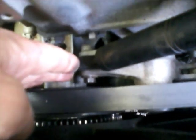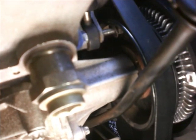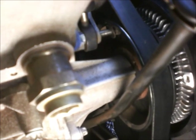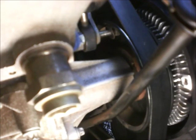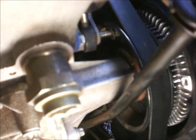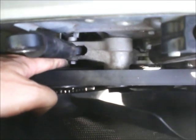Let's see how far it goes — if I can lift the shock. Of course, as usual, something is in the way. The bolt itself will come out, however its washer is hitting the pulley — the belt pulley from the water pump. There is space for the bolt to go further and clear, but that bolt has its own spacer and cannot be moved because of the thread. So we have to start removing more stuff.